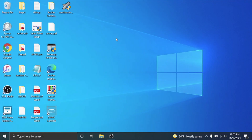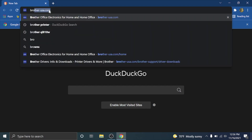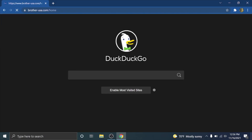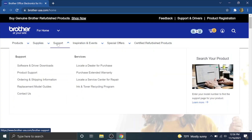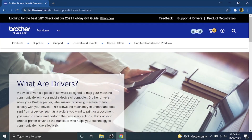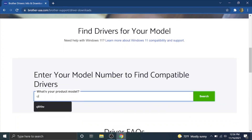For Windows — make sure you don't plug your printer in until indicated, as Windows can auto-install drivers and make the process more complicated. Open your browser and navigate to brother-usa.com — I'll put a link in the description. Once the site loads, click the 'Support' dropdown, go to 'Software and Driver Downloads,' and in the search bar type your printer's model number. Ours is the QL-810W.